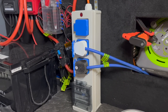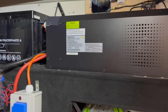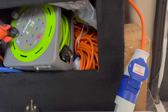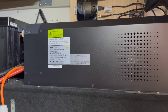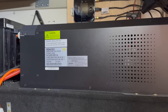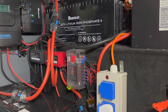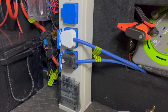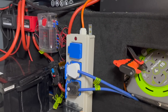This is my mains setup. I bought one of these camping kits so it's got an RCD connection built in, and that all connects back up to my Renogy 2000 watt inverter slash charger. That gives me mains sockets around my van when I'm on hookup, or mains sockets through the inverter. If the inverter does have a mains hookup, it will start charging my two batteries with 75 amps of charge — so they both get around 30 odd amps each. Wiring up my sockets has also given me RCD protection plus another socket in my boot.